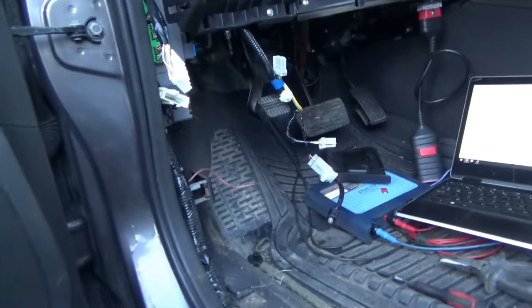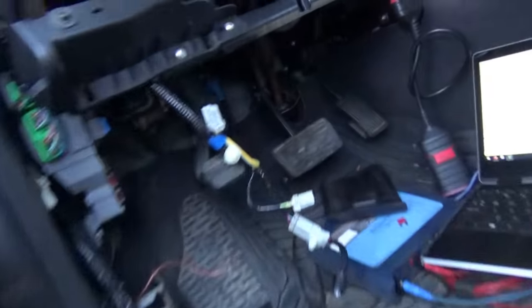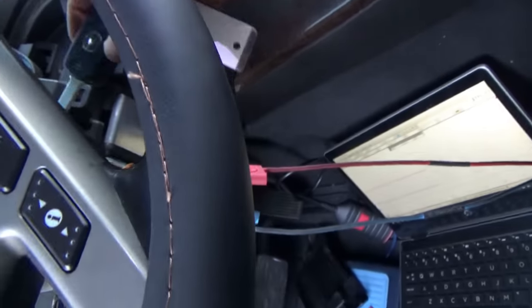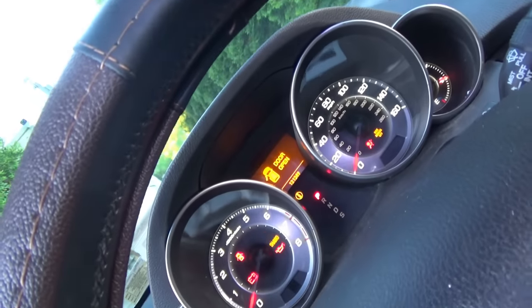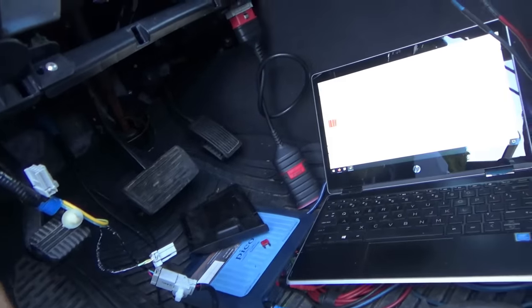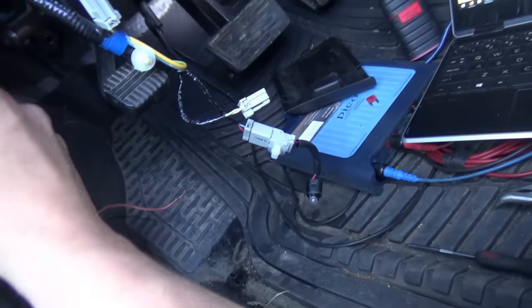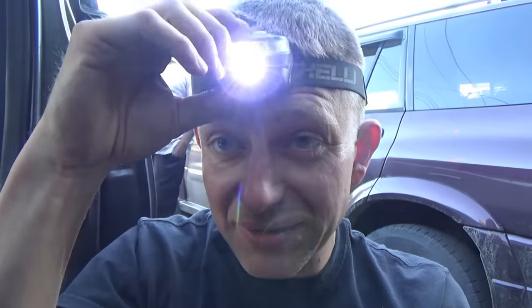Next shot, everything is put together with the scope rolling showing nice clean waveforms. The connector is plugged in, the owner has three keys — they all work. Beautiful, no green flashing key. Fires right up. You can tap that connector all day long and nothing happens. It's all clean, and it no longer has that constant power to build future green crusties. Thanks a lot for watching. Check out the waveforms in the link in the description below — I always try to post the PicoScope waveforms so you can follow along. See you guys next time.